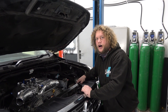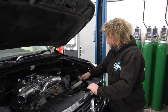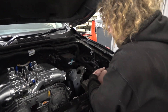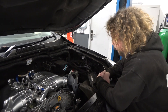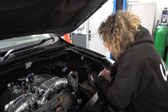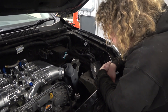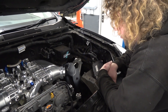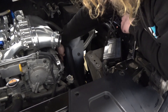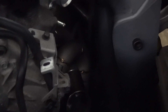Welcome to the world of the Navara R, where I have made a terrible mistake. I thought it was all going quite well because I managed to get the manifold in, but I didn't bolt it up completely tightly yesterday, thinking that would give me more room. What it has in fact done is bring the manifold closer to the turret they've welded in here. I have a problem — this pipe is now touching the strut. There's a gigantic design flaw on my part.